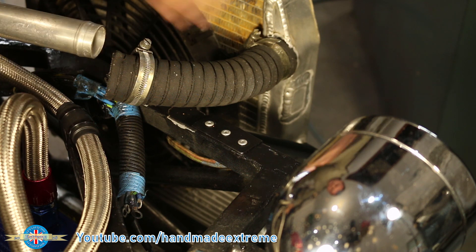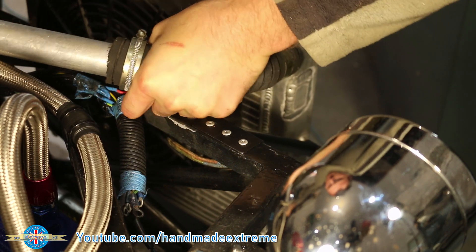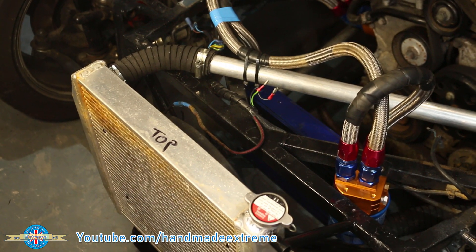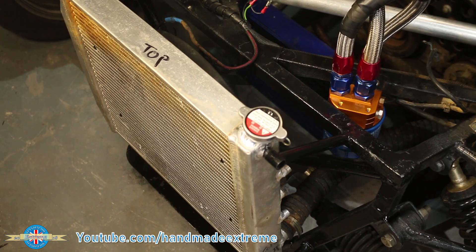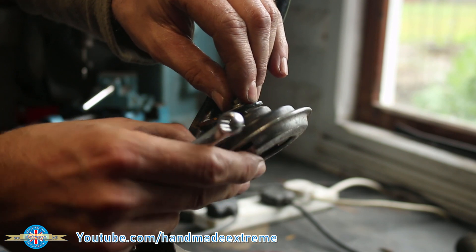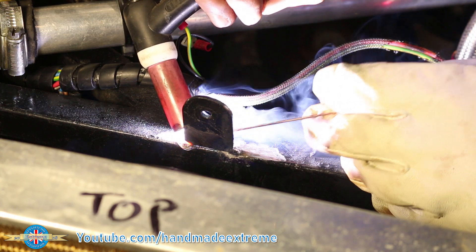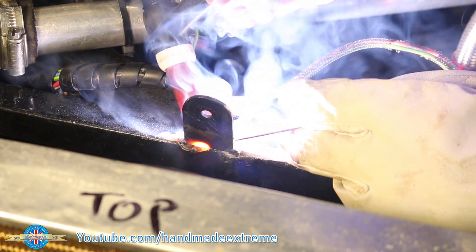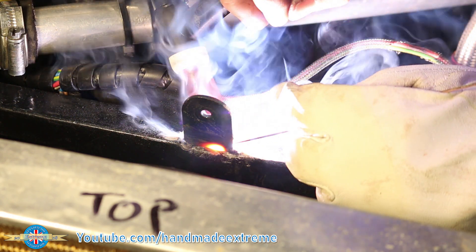Because I'd moved the radiator further forward the hoses weren't quite long enough. Luckily I had a length of aluminium radiator tube left over from another project that just happened to be the right size. Here's what it looks like so far — I've not gone mad tidying up the oil cooler hoses just in case I find that I need to modify the oil system once I've taken the car for a test drive. In the UK a horn is a legal requirement, so I salvaged that from one of the original radiator brackets, cut off the original tab, and re-welded it onto the front of the chassis behind the radiator — I picked this location purely because it meant I didn't have to lengthen or shorten the horn wiring.